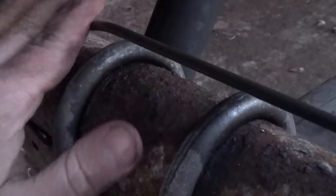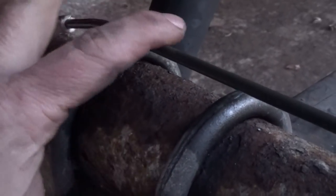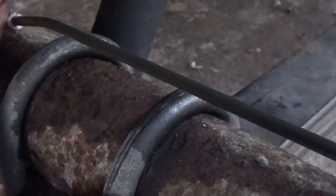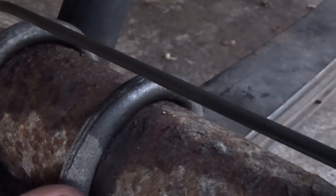Okay, I've got that bracket tightened down to secure the brake line to the axle. And look at that rise right there. Just tuck my finger under both ends of it. No one near touching the U-bolts, plenty of clearance. Cosmetically looks appealing because it's a nice gradual transition straight into the wheel cylinder. Sweet. Now I can bleed this baby.